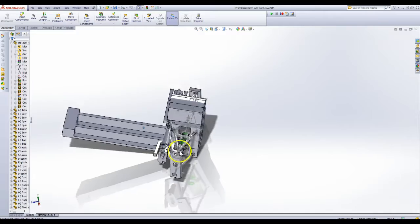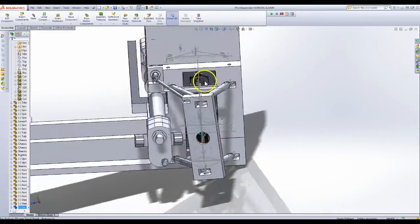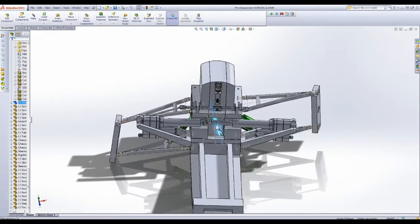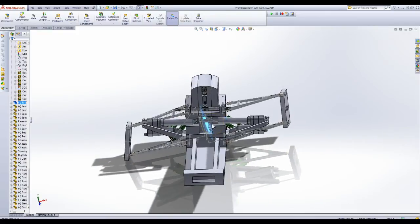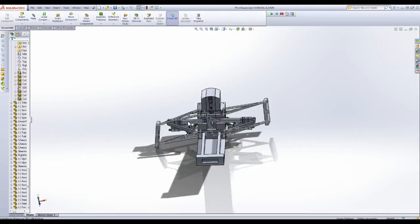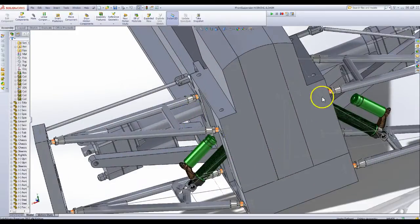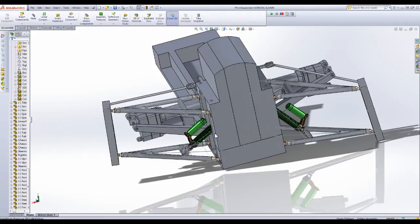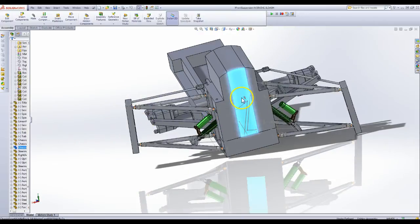The two dampers with the springs go up through the center of this frame and connect to the tilting frame. Essentially, to tilt the car you're just moving the dampers. The springs will push down on one side and pull up on the other, and that will cause the uprights to tilt into the corner. I took a long look at the Piaggio MP3 three-wheeler design and realized my past suspension design had the upper A-arms connecting to the tilting frame — which is the incorrect way to do it. To tilt a car, you need to just move the dampers left and right.